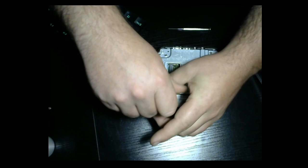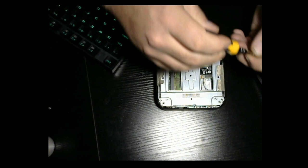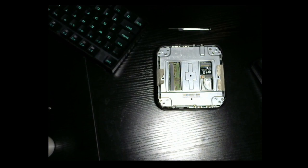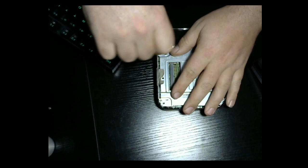This is also a good opportunity to upgrade your RAM capacity if you wanted to do that. This particular Chromebox has 4 gigabytes of RAM, which is plenty to run a Minecraft server. 2 would be plenty for probably up to 5 players in the server at once. If you plan on running more than 5 players, I would recommend going a little higher than 2. I've run a Minecraft server off of 4 gigabytes before with up to 20 players in it without any major issues.